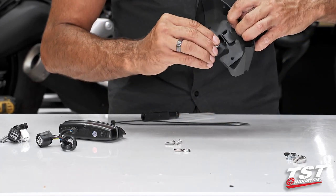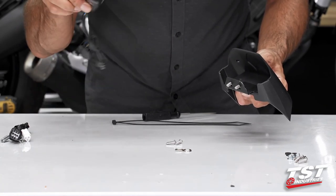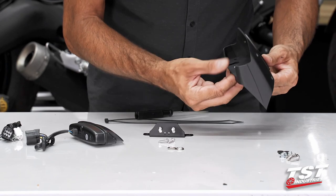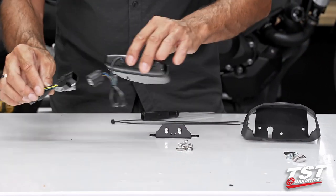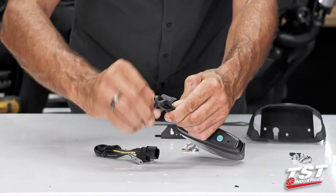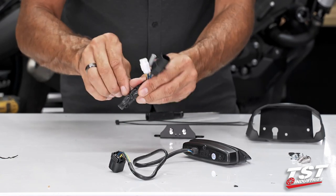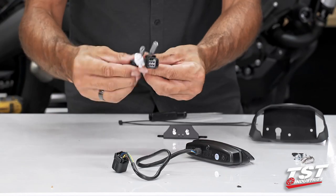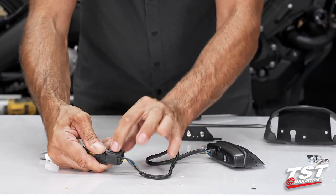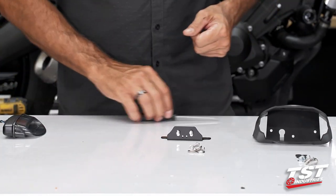These will be responsible for clamping all of this together — basically going from the back of our cradle, then we have our license plate bracket carrying L-bracket, and then our taillight. Now here you see a sub-harness that goes with our taillight. We manufacture this taillight for several different uses, so to make sure that you guys don't have to splice anything, we make a vehicle specific sub-harness that connects to this large six-position plug. On the bike side, it terminates in Yamaha specific connectors — signals and taillight. Go ahead and plug this together, make sure it makes a little snapping noise. We've also provided you with two wire ties — I'll show you how to use them a little bit later.